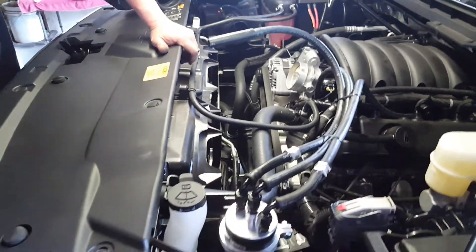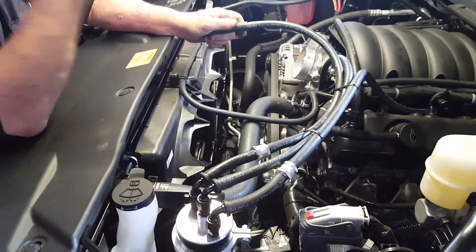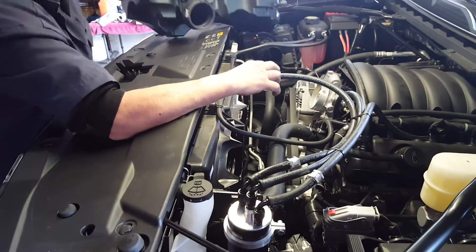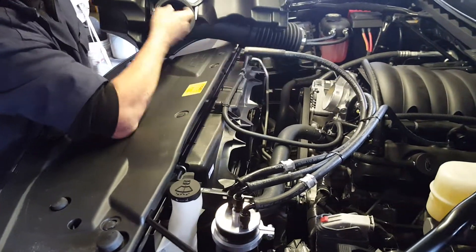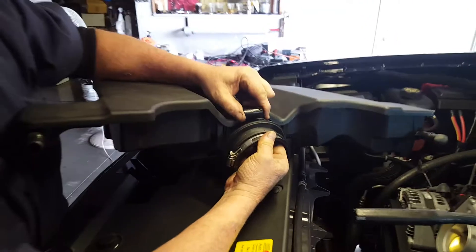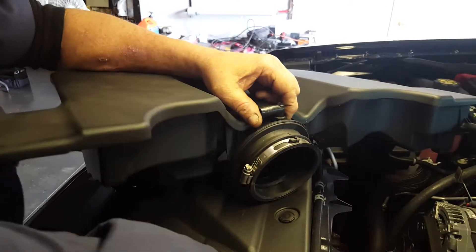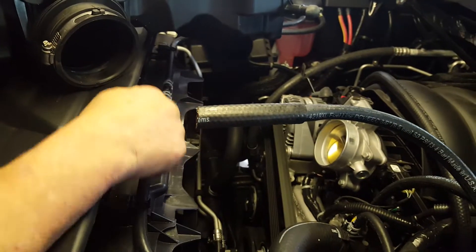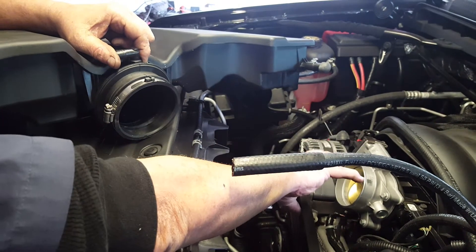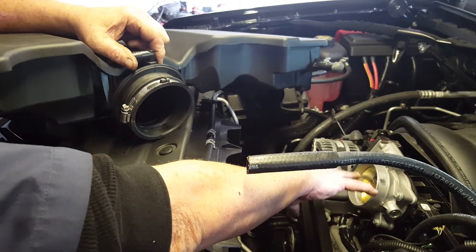For our secondary evacuation when you're under acceleration or at wide open throttle, the only place you have to drill is right here into the top of the air bridge just upstream of the throttle body. This area the reversion pulses don't hit until you're well over 8,000 RPM, so there's still good suction, and at wide open throttle you've got even more suction up here.